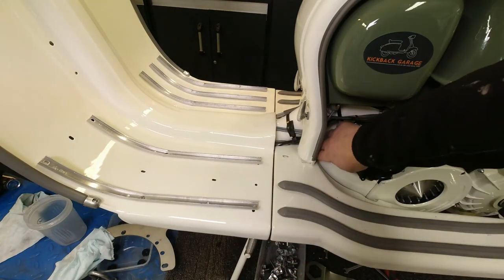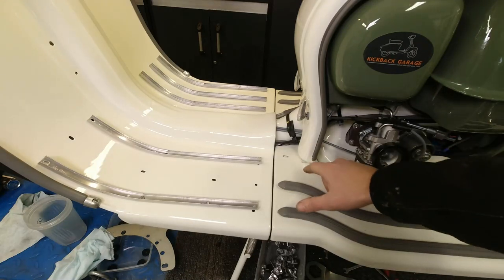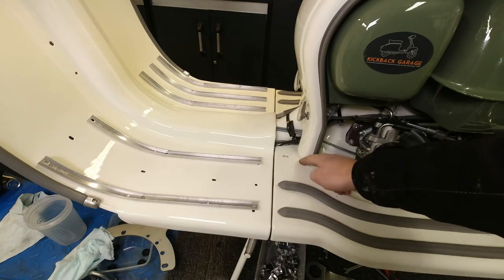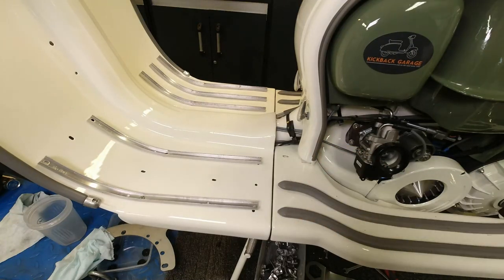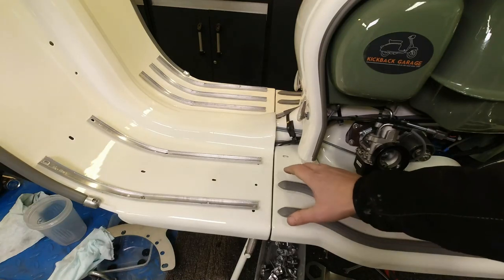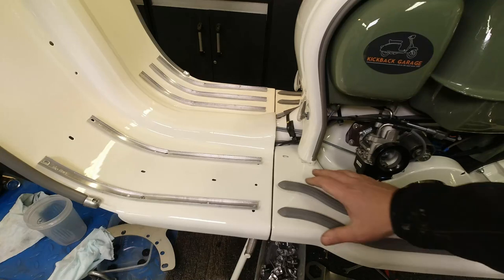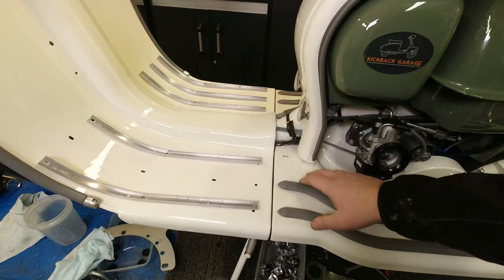I really hate it when they touch because that leads to vibration noises. You should have a little bit of leeway as the slots on the footboards are ovalized. If you have to, you can gently press it forwards in the middle. I'm actually pretty pleased with that. What I'm not pleased about is I've scratched my headset just a little bit at the back. I fit a clear protective tape so that I don't scratch these things when I put them in and out. The rear footboards were painted last year — I haven't painted them this year, and that's why they were a little bit dirty. But the nightmare is I have to take this off again because my flywheel cowl is not on — I have to fire this thing up and check that I'm at 17 degrees.